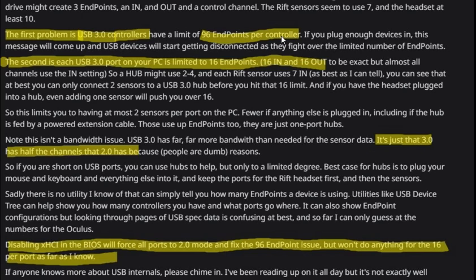The question is: how many controllers do you have? You can't see that easily — the controller is a thing on the motherboard. As long as you don't open your computer, you have no idea if you have one, two, three, or more controllers. Even when you have three USB plugs, it can be that you have just one controller. Each USB 3.0 port on your PC is limited to 16 endpoints in and 16 out — a total of 32 — but they all share the 96 endpoints per controller. So it doesn't help if you have a lot of ports but only one controller.